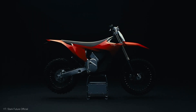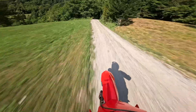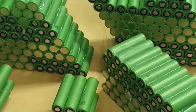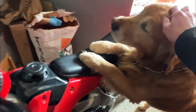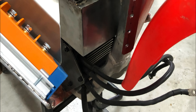At the time Stark didn't exist yet — big power electric dirtbikes were extremely rare. This build was probably one of the first in Europe with this much electric power in a dirtbike frame. Every part had to be solved from zero, and that made the whole project exciting. We used 630 cells and built three battery boxes, giving the bike 6.3 kilowatt hours of power. First we designed everything on the computer, then we made full-size cardboard models to test the shape inside the CRF frame.